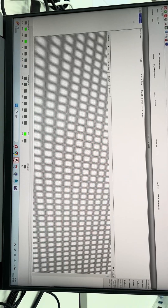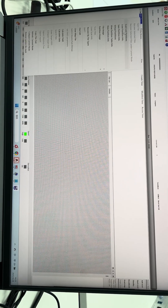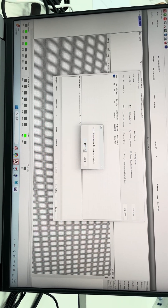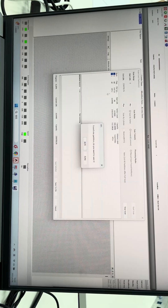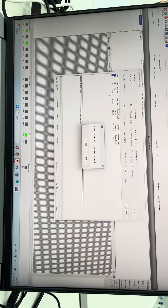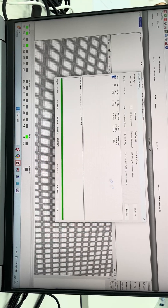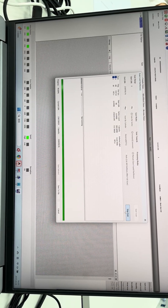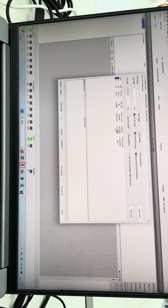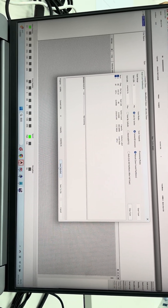Now this SSD with bad sectors has been detected properly. Click OK, then right-click to scan for partitions and click Start Scan. The first partition has been detected. The second partition — an Apple HFS Plus partition — has been detected. Click Yes to save it. We can now stop the scan because the full capacity of the SSD drive has been detected.